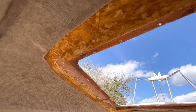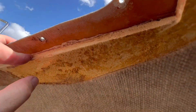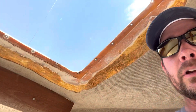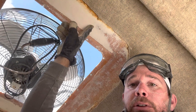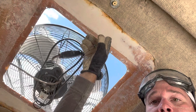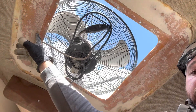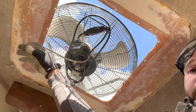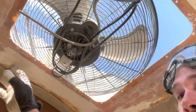Once you pull this headlining off, you can see it's just foam right here, about half-inch thick. I ended up cutting the carpet back a little bit more and I'm about ready to get the sander out and sand this foam down. I did call Precision and confirm that you could glass directly to this foam — it will take a bond — but the problem I'm running into is a lot of delamination of this foam to the fiberglass above it. On the port side I was able to basically just pick large chunks of foam out, which was probably contributing to a lot of flex I was feeling when I walked on the deck.